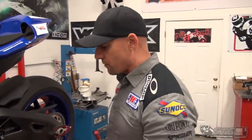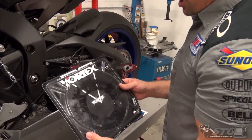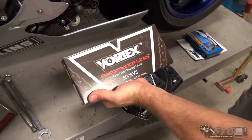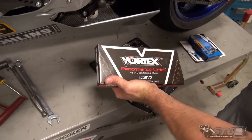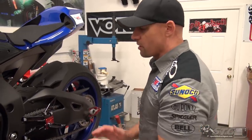We're going to go with a 520 chain kit. We've got a hard-coated aluminum black rear sprocket — it's a new design — a steel front sprocket, and their 520 RV3 racing chain that's meant for up to 1,000 cc's. For gearing, I'm actually just going to use stock. I'm going to Daytona next week, and I want to get as much top speed out of the bike as I can.